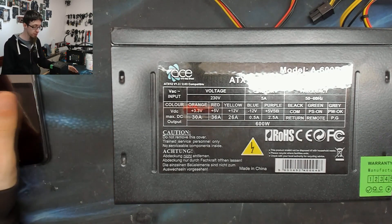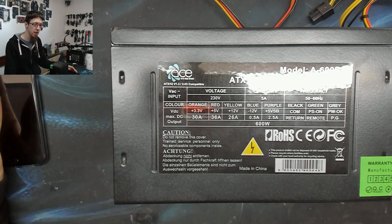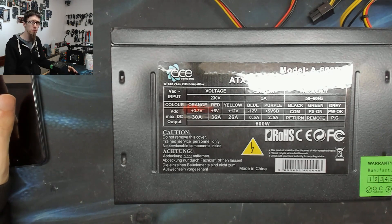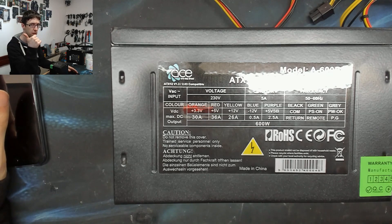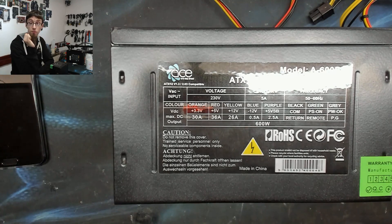It's apparently a 600W power supply, and you'd expect 600W to reach all your components. The bits you care about are the CPU, graphics card, hard drives, and SSDs — the big three workhorses. All of those are powered from the 12V rail and represent the biggest power draws. For example, an i7 is a 95W TDP, an i9 is probably 120W or more under full load.